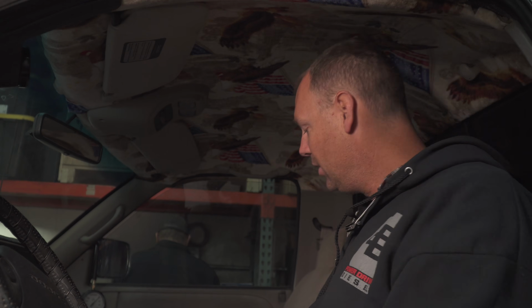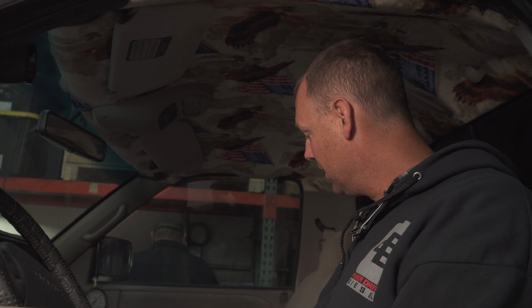All right, guys. This is the first of our turbo testing. I think 2 turbos and a train swap is going to about burn up a whole video. So right now, the K27 is a nice little upgrade for the HX35. We picked up a little over 20 peak horsepower. We picked up a little over 30 towing horsepower with the same EGT, a little bit more boost. So it's a nice little upgrade if you have a worn out 35. This is a great option. Next up is going to be our HX35 with the 60mm HE351 wheel. I suspect we're going to keep going up in power, and it's going to be awesome. So wait for that next video to hit.